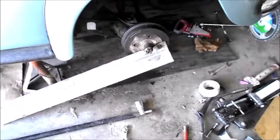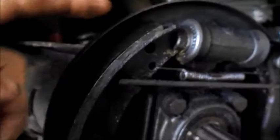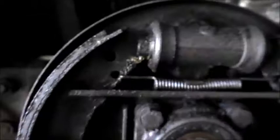I've got to get access to that brake cylinder back here, which means taking the drum off, which means getting that nut off. I'm cracking out my heavy-duty stuff — 36mm nut, breaker bar, and my lock to hold everything in place. It was nice and clean back here, and now it's a brake-fluid-encrusted mess. That is coated in brake fluid right there — no wonder the stopping power in the back was diminished. This is the side that's leaking — you can see a big smear underneath it right there. The other side is looking alright, but that's got to go.